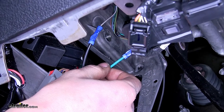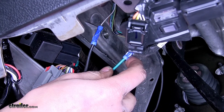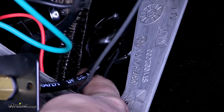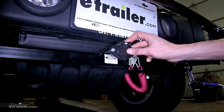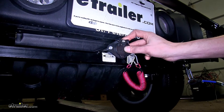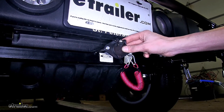For the monitor light inside our motorhome, we attached the indicator light wire to the cold side of our brake light relay previously installed — that goes to the green wire — and routes out through the same grommet hole in the firewall as our airline tubing. We connected our indicator light wire to the front of our Jeep's six-pole connector using the pin typically used for electric trailer brakes, since we're using the existing trailer brake connector inside our motorhome to pass the signal to the indicator light without running a new wire.